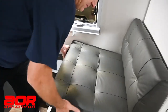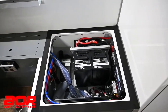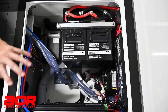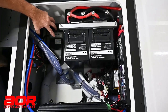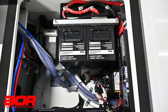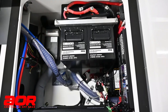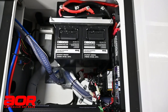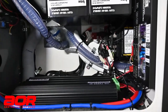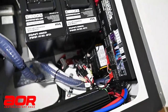I like to call this the money box. This seat is generally where, if you've optioned up to go for lithium batteries as these customers have, the money is. Inside here we have our diesel heater located down the bottom. This customer has upgraded to two 150 amp-hour lithium batteries each — so 300 amps of lithium in two batteries. They're a bigger battery than standard but give us more amperage. We've also got our battery management system on the side, along with relevant hoses and fuses for the water tanks and waste running through the floor to the outside tanks.